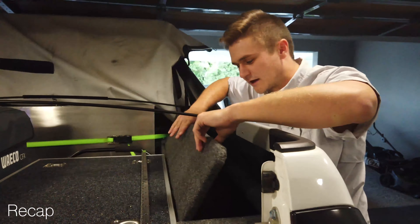So on the left hand side of the tub, as you can see we've got our King's 300 litre per minute compressor. It's a cheap pump but it's what we got at the moment — it's pretty good really, we've had no problems touring Australia. We're going to secure this to the side of the fridge here at the bottom, build the end in, and put a tap fitting and an air fitting so when we air up we just have the point. A couple of switches and another switch with some LED lighting throughout the tub so we can see. This bit here will be built in at the end. There'll be a false floor on top of the air pump and a water pump down here on top of that too, just with a little pull-out vent. The top will be open because it butts up to the tonneau, so we can just open this side of the tonneau for more storage on top.